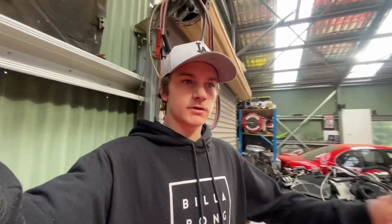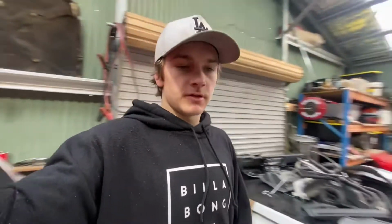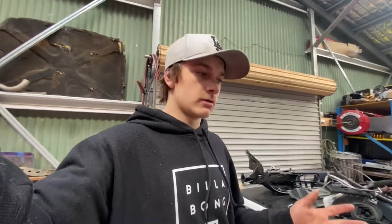But I've worked out, I called up an engine builder from up in Sydney, and they gave me a rough price of what I wanted, which was a worked 304, which is standard stroke, cam, headwork, things like that. And they said the only way I'd be making power out of the standard stroke is if I rev it to 7200 RPM, which is pushing it. So the extra couple grand, $3,000 or so, it's going to be probably better, because it's better to go 355 stroke.